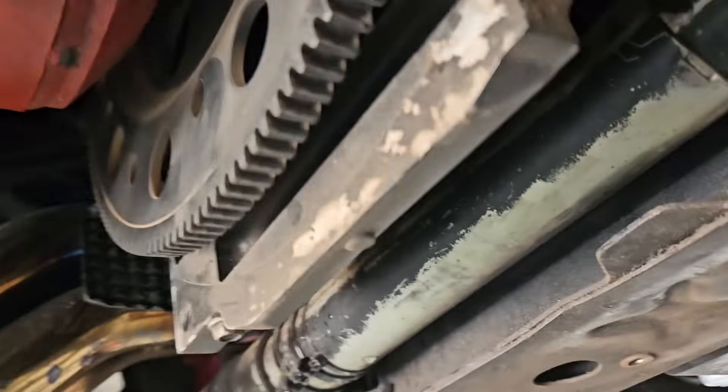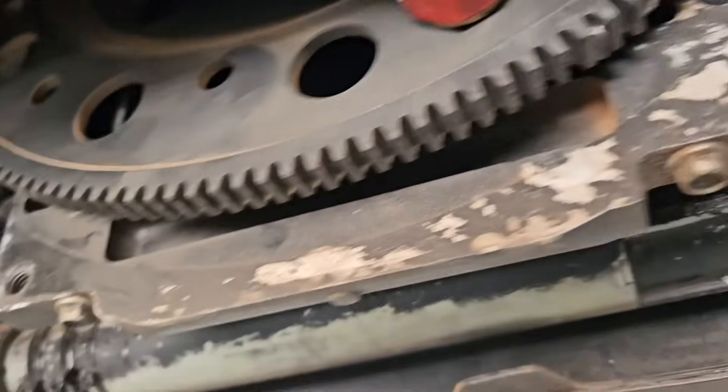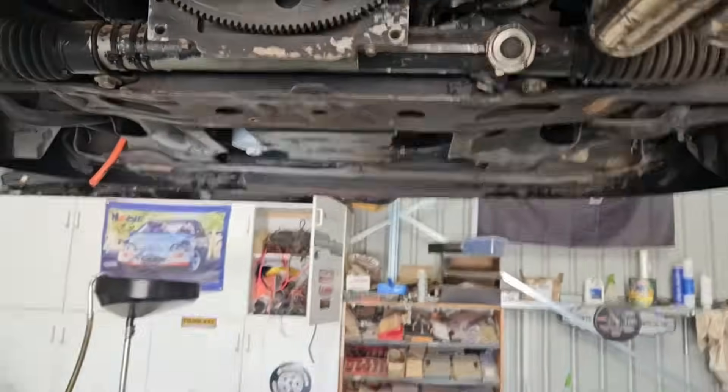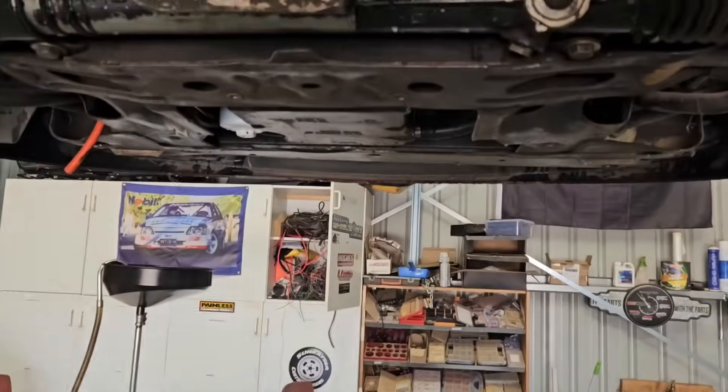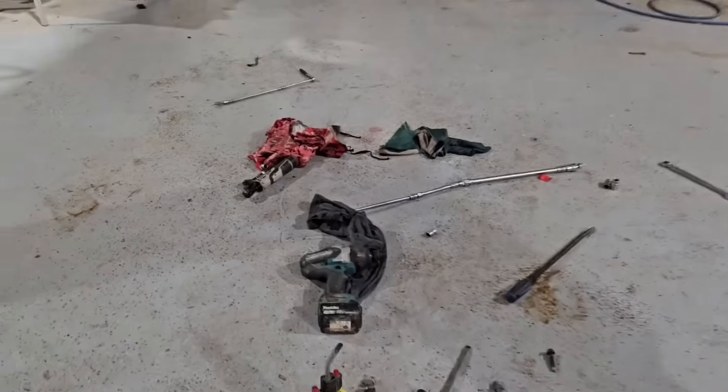I think my starter's okay. Now when it winds over it goes clunk, clunk, clunk. F***ing spewing. Box out — going to have to put another ring gear on it. Oh well, here's what it is. It's out. Took me about an hour, got it out, pretty easy.